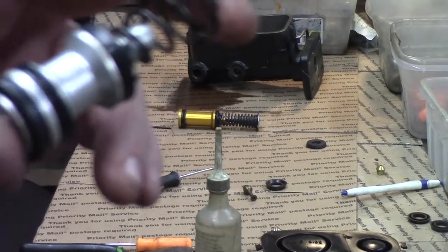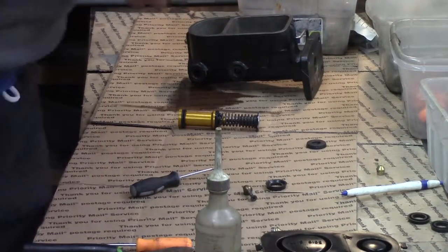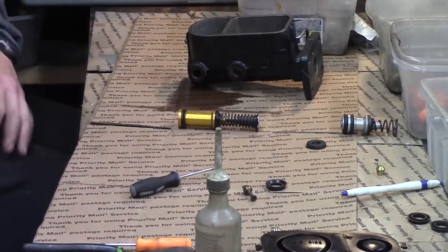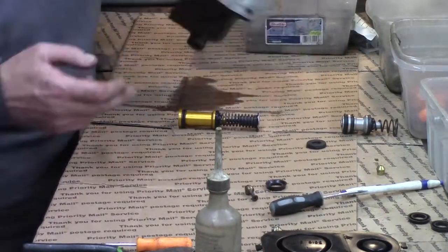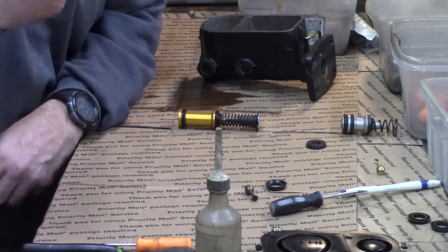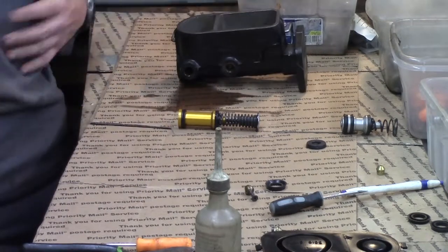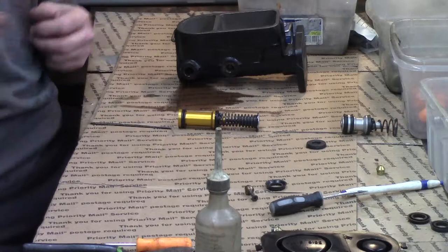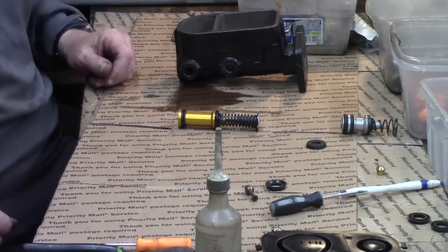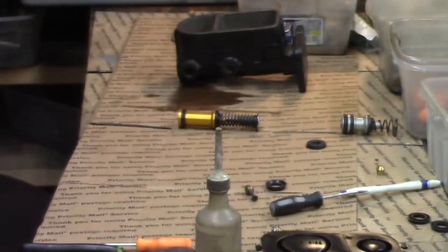You can see now how it works. All a master cylinder is is a hydraulic cylinder. Any dirt or debris up underneath one of these cups where it's wiping back and forth will have you leak — and that's one of the problems we run into on some of our rebuilds, about five to ten percent of the people that we do. This one's in great shape, it doesn't even need a brass sleeve; this is the original bore, it's in really mint shape. But we'll redo their master cylinder and they'll bolt it back on there, and a couple days later they'll say it's weeping out of the back. What's happened is you bolt this master cylinder on there, run some fluid through there, and it mixes up — you've got dirt in your system. Don't tell me you don't have dirt in there because you replaced everything, because I'm going to tell you, you're wrong. Nobody replaces the block over the rear axle, and you ain't gonna get all the dirt out.